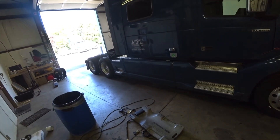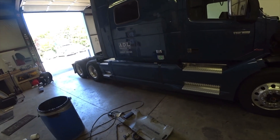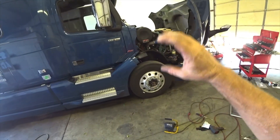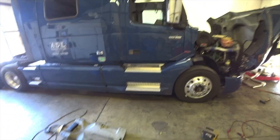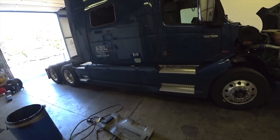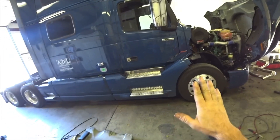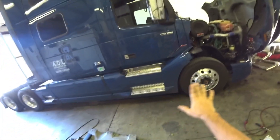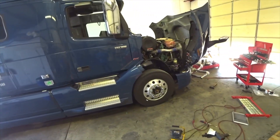It could have been a trailer because some of the trailers had bad brakes. The boss just had the brakes done on one of the trailers at a shop, but I checked it - the s-cam can move half an inch in each direction. It wouldn't even pass a DOT inspection and it's got brand new brake pads on it. On these Volvos, you press the brakes down and they apply, but then you can press them all the way and it feels like mush - that's how all Volvos are.